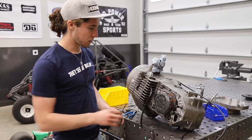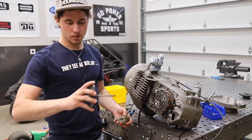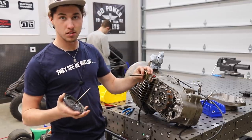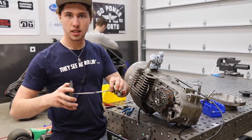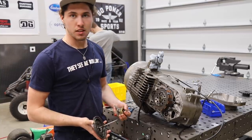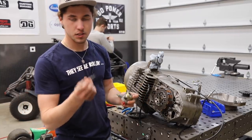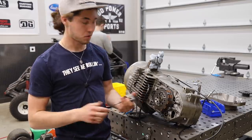I don't know. Well, we got good news and bad news, and the good news is mostly that we can work with what's bad. The problem is this clutch is designed to spin, and because this rod is spinning really, really fast, and this rod was stationary, which used to just go to a solid mount lever, what happens is this is spinning and it goes against our bearing balls and it just completely melts, and it gets friction welded together, and that's why I had to snap it apart. So now we have two bearing balls that are welded together, and it's just kind of a train wreck. But the good news is, what can happen with this setup is that this rod can spin inside of this. This is like a $20 Harley part I got off of eBay because it fits a 6mm rod like this one. So if we wreck this thing, at least it's not a proprietary rotary part that doesn't exist anymore.